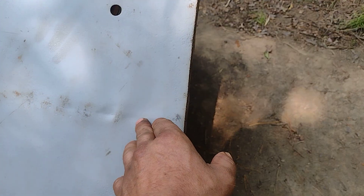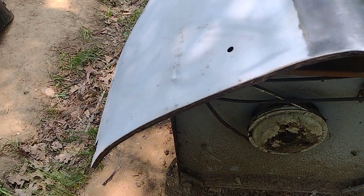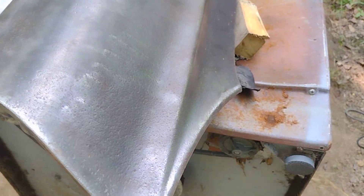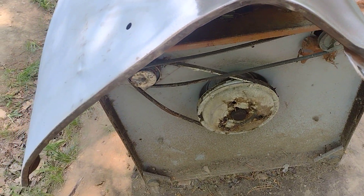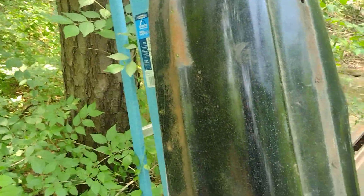I thought about welding a bolt on there and just attaching it to my slide hammer to pull it back out — might try that. I want to get all that out of there as much as I can because when I paint these fenders I want it to look decent. I did clean up all the lip and everything too. I got our trim off on this side — got that spear off too — and I took a sharpie and marked them between driver's side and passenger's side to keep them separated.